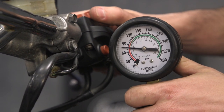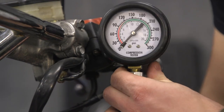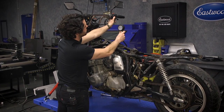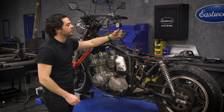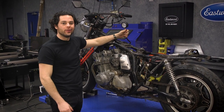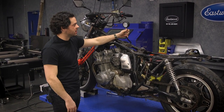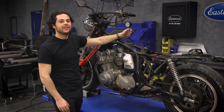A little bit less than the first two on cylinder three, but still right within the same range. And cylinder four is still within that same range — 85 to 90. Clearly we've got a 40-year-old engine here, so it needs a little bit of a freshen up. We are going to talk to the in-house engine guys and see what they have to say about this thing. But the compression tester did its job just fine.